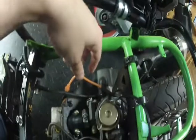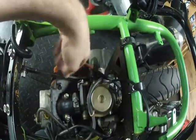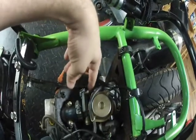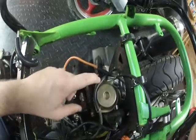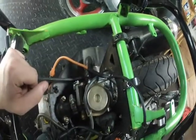The other thing we found today was the nuts right here that hold the throttle to the carb. One of them — the bottom or top one — has been unscrewing itself. I really don't want to put Loctite on there, so what I'm probably going to do is pull the whole carb off so I can get two wrenches on here and really tighten them good.